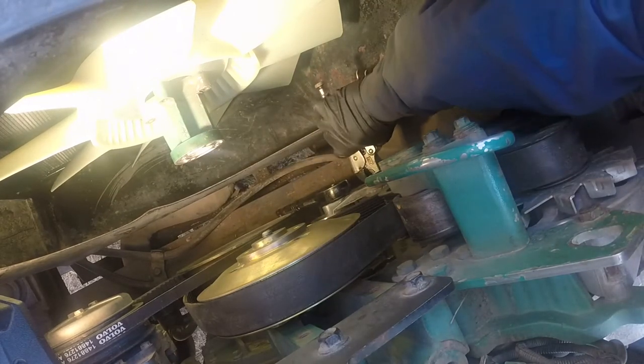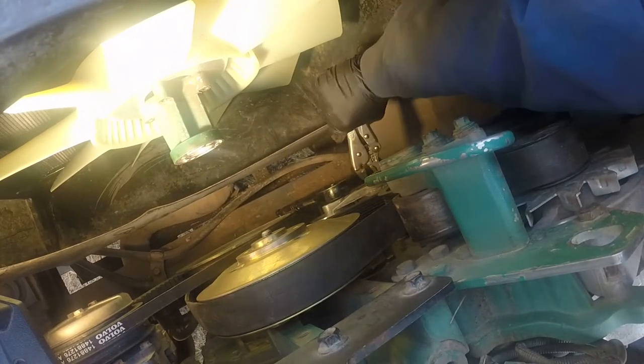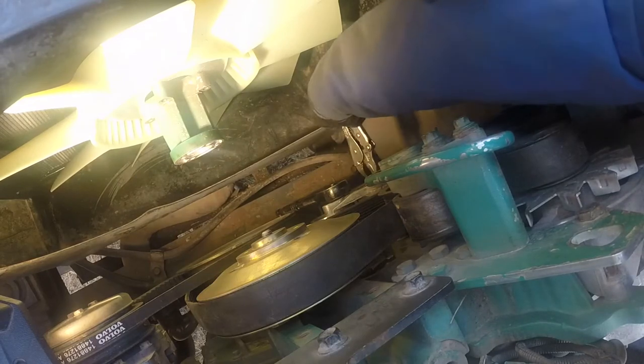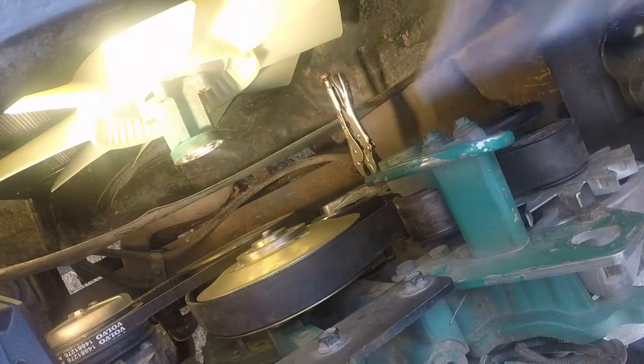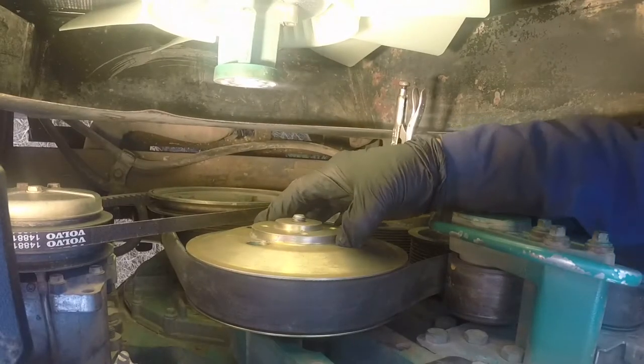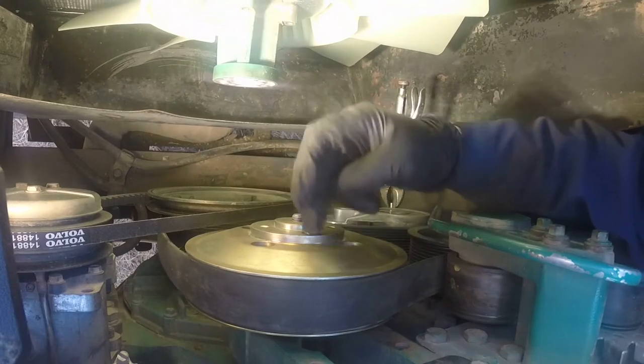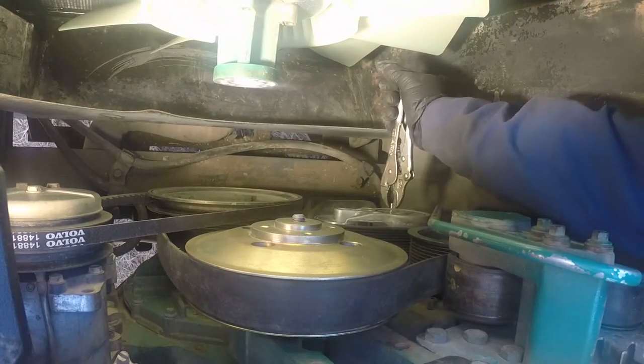And now we have to pull that metal lock pin from the tensioner. When we installed it, the tensioner was locked, and now we're pulling it out. In the video down in the description, you will see how to install the belt properly. But the belt, as I said, was replaced not a long time ago, and the belt is good. We inspected it, and yeah, it'll go for another few years. Okay, let's pull it out.